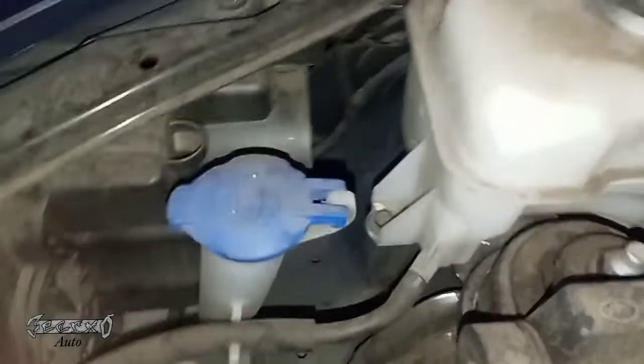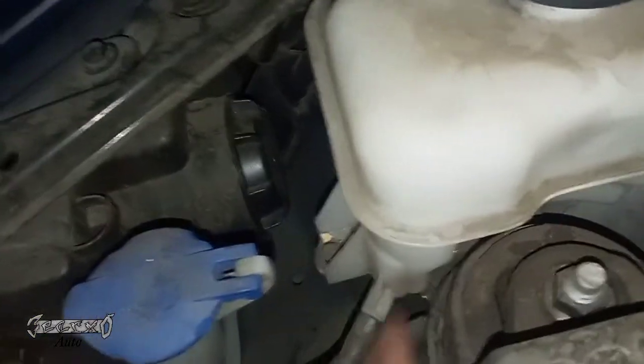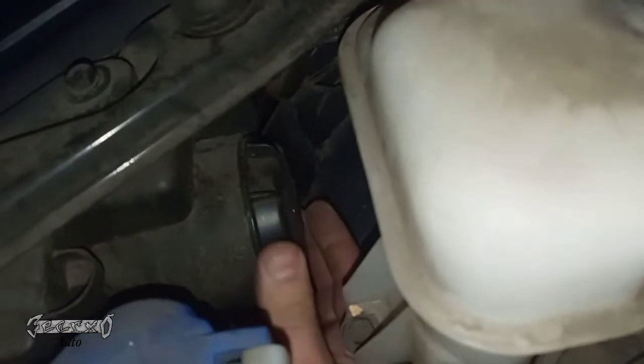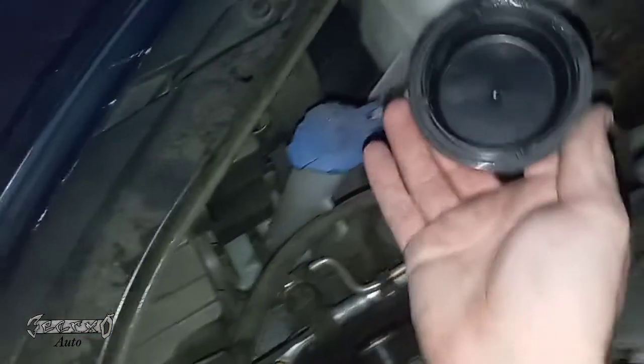To replace this, I'm going to be doing the passenger side — this one right here. Now you could reach in here, especially if you have small hands. What you do is twist it towards the engine, and once you twist it, it unlocks and you can pull it back. That gives you access to the headlight, and your bulb's in there.